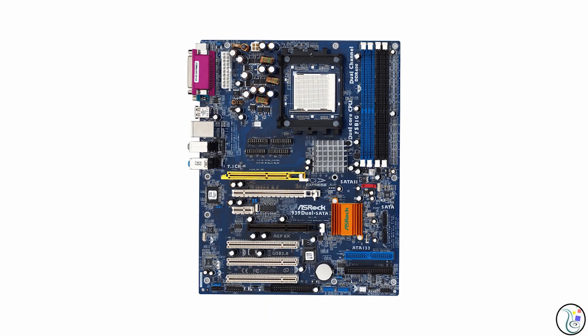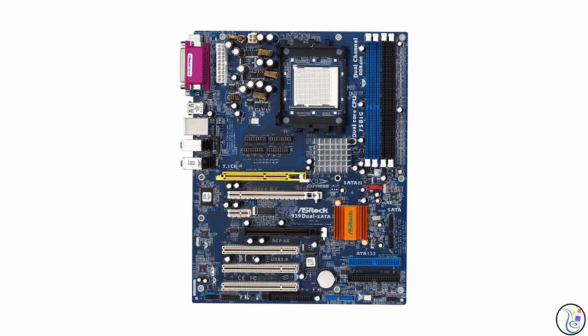These mods are doable if you're driven enough, but far from convenient. For whatever reason, ASRock bestowed their AMD platforms with many more BIOS options — likely because different design teams tackled different platforms. The 939 Dual SATA 2 is a particularly awesome motherboard and my personal favorite for Socket 939, but you quickly run into performance limitations with Athlon 64 CPUs when benchmarking anything past the Radeon 9800 XT.